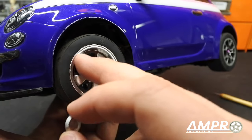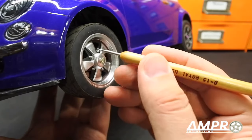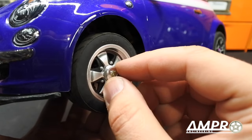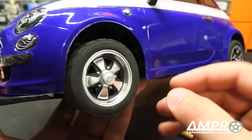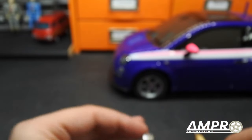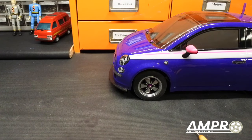Once you've glued the flower portion in place, the lug nuts pop right in there. But this is more of a shelf-type feature — there's no lip that gives you good grip on it. So if you want to keep this on and run the car, it's glued on. Maybe you can add a little thickness with super glue to make it stiffer, but I simply don't recommend that. The ultra-detail plastic for these flower pieces and center caps is simply too brittle for running. So I recommend the center caps are used for display purposes only. These are Porsche-styled center caps with a little raised feature giving the Porsche logo impression. If you own a Volkswagen Beetle, there's also a Volkswagen variant, and a third one with a flat face if you have a Porsche emblem decal.